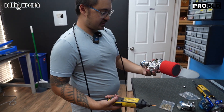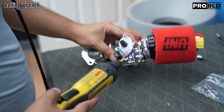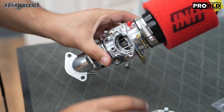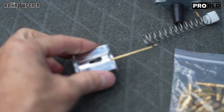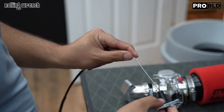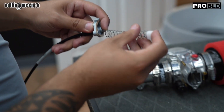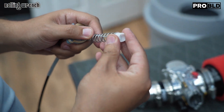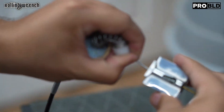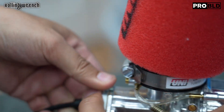The last step is the only part that's a little bit tricky if you end up getting the kit separated and not completely put together. I'm going to take the top off here — this is probably the hardest learning curve when talking about how to do these, and it's always difficult to explain. We'll go ahead and take all these components out. This is the slide, the needle, the spring, and this is our PWK style cable. This guy will go right through this little part here. Keep in mind, you don't have to worry about any of this if you get it as a kit — we'll do it for you. Then you pinch this part back and put it into the slide like so, make sure it's settled right in there, and it bolts back in.